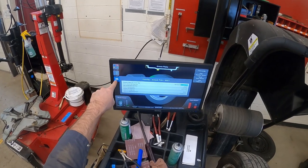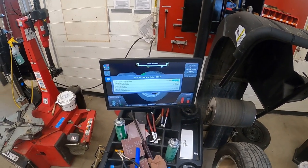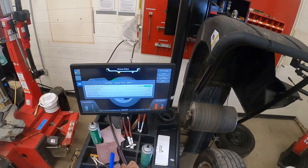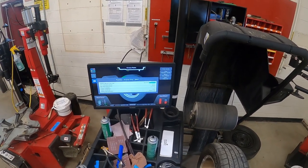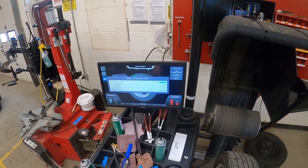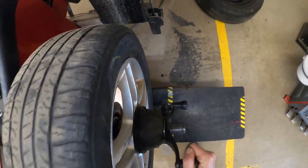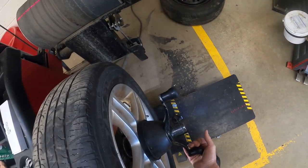This informational page also has some other neat stuff where it tells you the pilot hole diameters on the front and rear wheels, the pitch circle of the wheel, the number of fasteners, the socket size, and the fastener size thread pitch. So if you needed to order anything while doing this job, you could call in knowing it's a 12mm by 1.5 stud or the nut was a 19mm size. Pretty handy. It'll also give you the pitch circle diameter when balancing wheels.